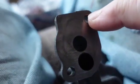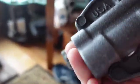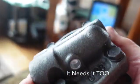Now remember too, I saw guys say this. These two pins that go into the bearing cap thing, be real careful with those because those snap right off. The ears break off. So there you go, baby. And so we're going to take this apart and we're going to blueprint it.